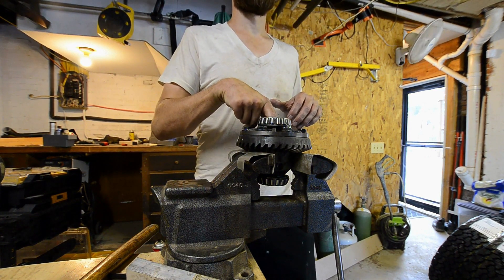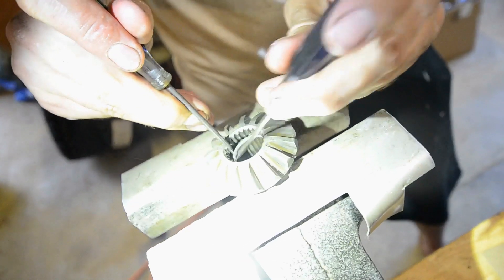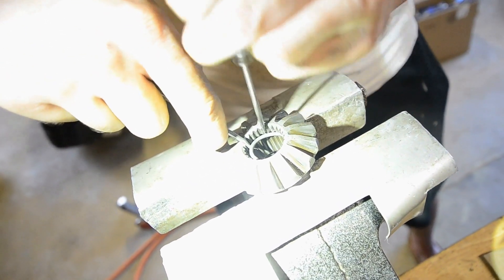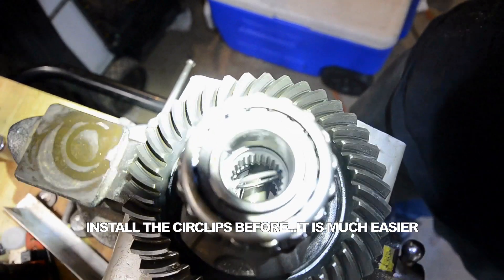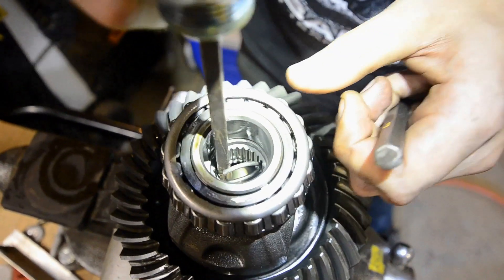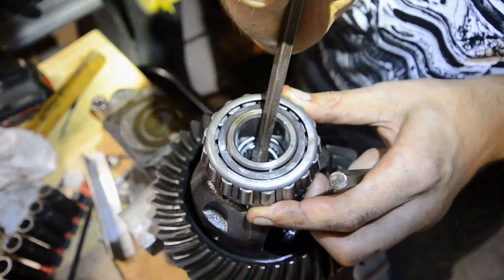Now, circlips. We're extracting a circlip — trying not to bend it too much, because the more you bend it the more problems you'll create when putting everything back together. I'm using this tool to walk it back this way to ease the tension as much as I can. Push this little circlip in there — you can see it down in there. Now we're going to bend it out, which is a little more difficult. As an alternative, you might consider installing these circlips into the locker before you put the locker into the differential carrier — but we forgot, so we're doing it this way.